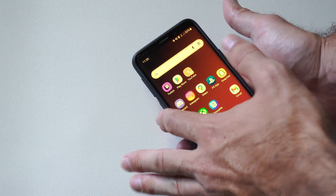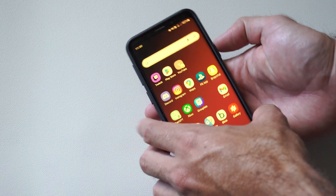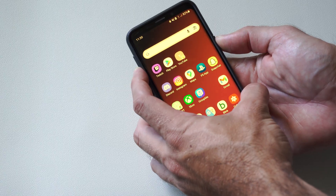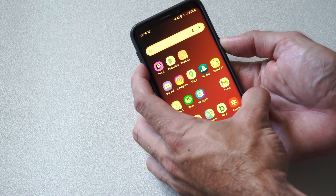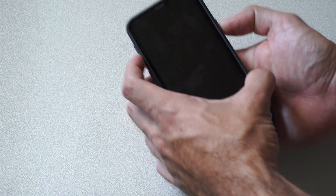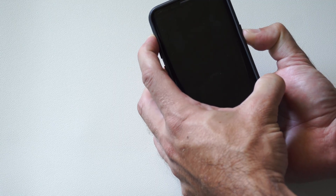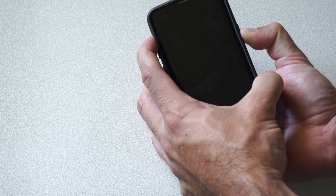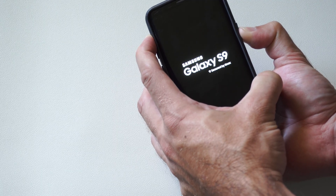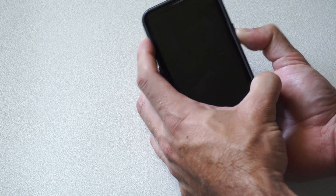On your version of Android, you might not have that third button — just press the volume up key and the power button. So let's do that now: power and volume down to force it off. We're going to take a screenshot, that's fine. Then once it force turns off, transition to volume up, Bixby, and power — press all three down at the same time. If you only have two of them, just press two down. This will restart it into safe mode. Once you see the logo and it goes away, you can let go.